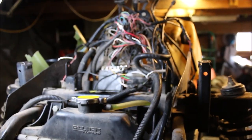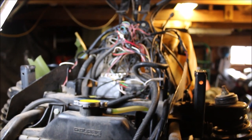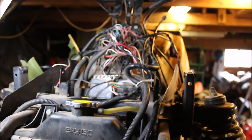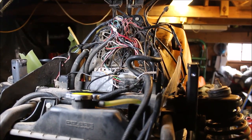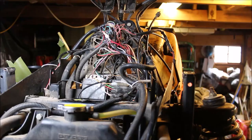In my past videos I've always said, if you've got no spark — or one spark, no spark — it's always the black wire to the CDI. Unplug that, and a lot of times you'll get spark. Then it'll let you know if it's your run-stop kill switch coming down on the handlebars, or if it's your CDI.